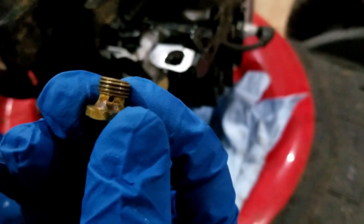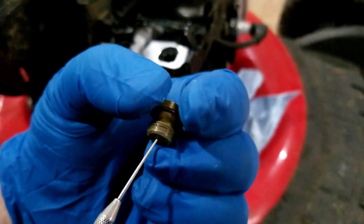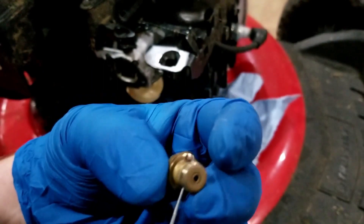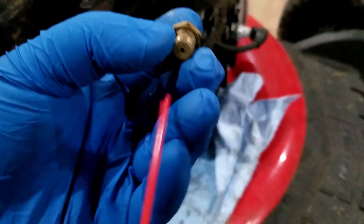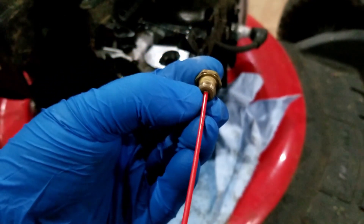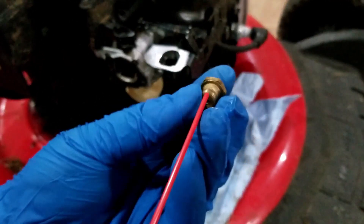Wipe that off with a clean rag — yeah, that's not too bad at all. Pretty nice. So there are a couple little orifices in there — see those holes? Always best to use a small toothpick or something to clean those out real good, make sure they're not gummed up. Just a little toothpick, nice and gentle, twist it around in there. Got a little bit of gunk out — a little bit of gunk in there. Get our brake cleaner — watch your eyes, but you should see two spouts on each side shoot out. That might have been a problem — just not getting enough fuel to keep going.